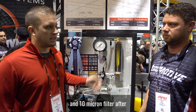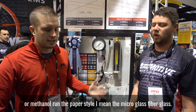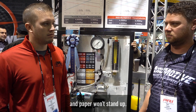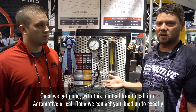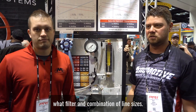Use a 100 micron pre-filter and a 10 micron post-filter. If you're running ethanol or methanol, run the micro glass style filter rather than cellulose or paper. Once you get going with this, feel free to call Aeromotive — they can get you lined up on exactly what filter, regulator, and line sizes you need.